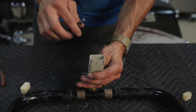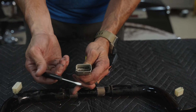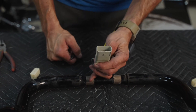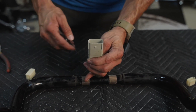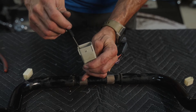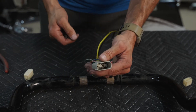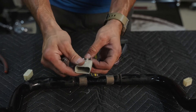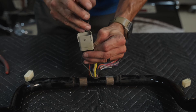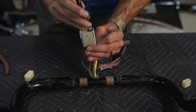Inside of this plug, for each wire there is a little tab. I like to use a small flathead screwdriver — if you're desperate you can use a paper clip, but something small with a flat edge. There's a tiny little clip in there like a door; you're going to lift up on the door and pull the wire out at the same time. Grab the back side of the wire, flat head in, and it'll pull right out of the back. Same thing for every one of them.